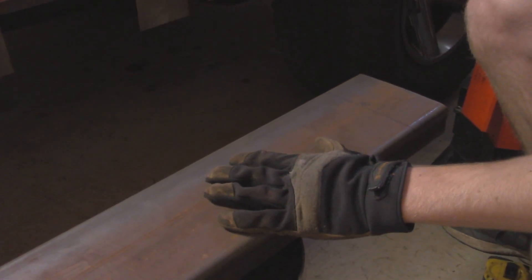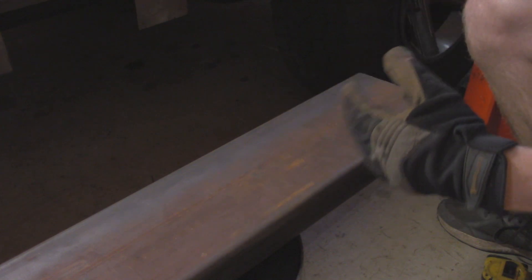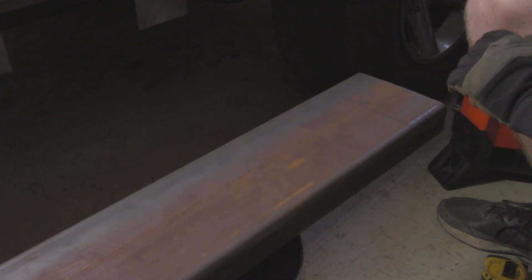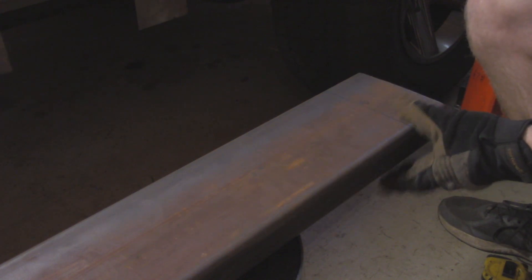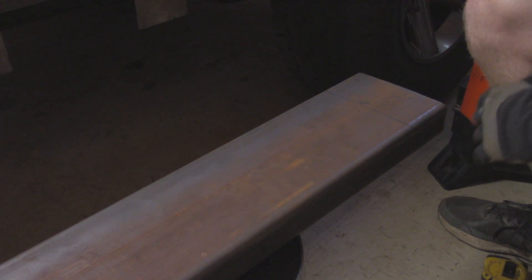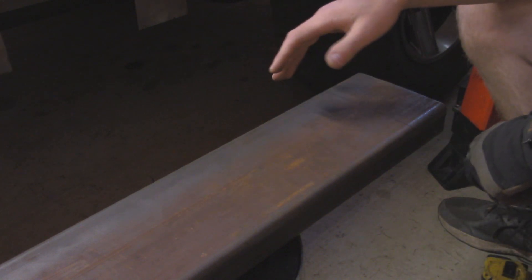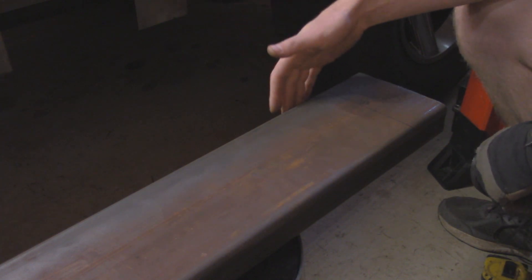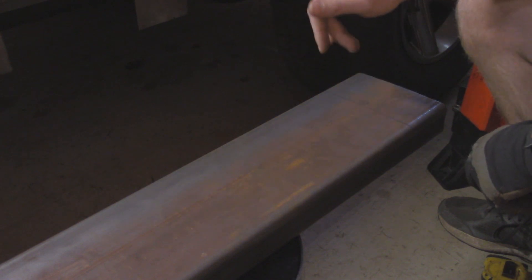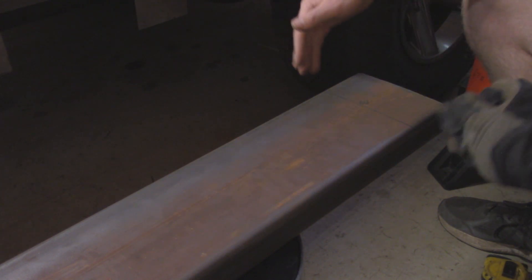Alright, so here's a piece of 2x6 steel that we're actually going to be using for this side over here. I had these cut from the metal supplier at 72 inches so that way I have enough room to basically work. We're still going to have to shorten it up, but basically right now I'm going to get this all prepped. Now I'm going to copy the design I actually did on my last Jeep. The front of the rocker is basically going to have an angle coming up, and these ends are going to basically pinch together. On the back side I think I'm just going to do a simple 45 degrees. Now one thing to keep in mind with this 2x6 steel is that it's welded on one side. If you have that exposed onto the outside of the Jeep and you paint over it, you can sometimes still see that weld. Now on these ones they're actually welded on the main 6 inch section, so the weld that we have here — I'm going to actually have that face towards the bottom of the Jeep.